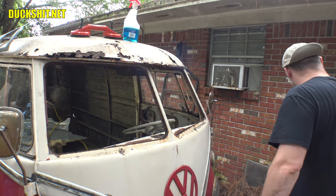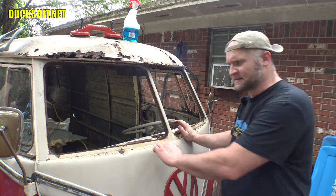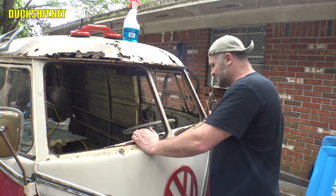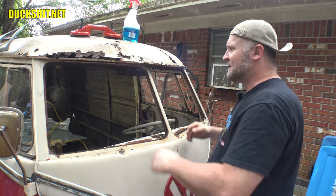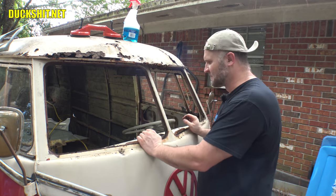It's gonna go in the same style as I did it over on Eleanor. I cut this vertically on both sides, then laid her new windshield into place, welded it around, then cut down the post and put the roof to where I wanted it.